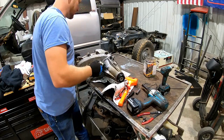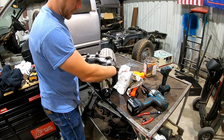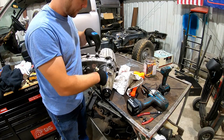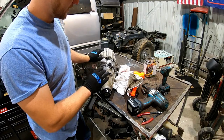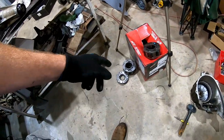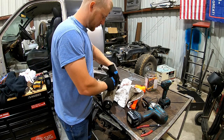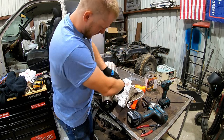One thing that is a little bit trickier with these compared to the light duty one is there is a snap ring inside this housing that goes on the outside of this rear bearing for the tail housing, and trying to get all the shafts to come down here so I can get that one in, I had to mess around with the bearing up front. And believe me, when you're doing these, if you're going to be robbing parts off of another one, keep those other ones separate, because you do not want to grab something and put it up here from one of those and start looking around going, where the hell did that extra bolt come from? Mainly the snap ring. If you've got an extra snap ring, generally speaking, you messed up. So keep all of them cataloged down there, and you should be good to go.